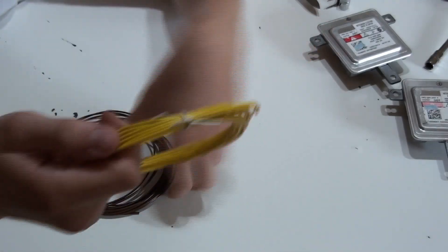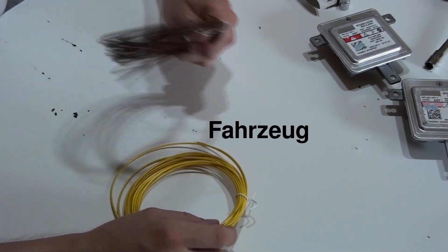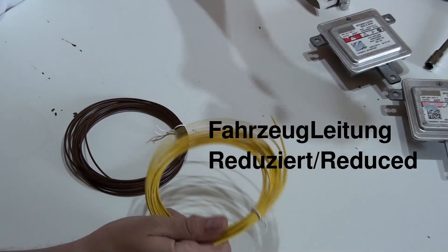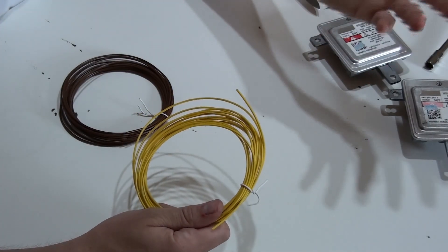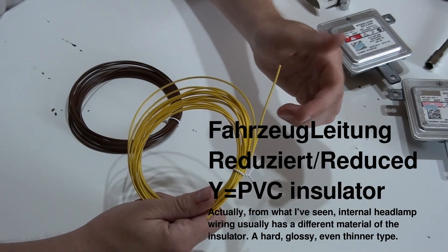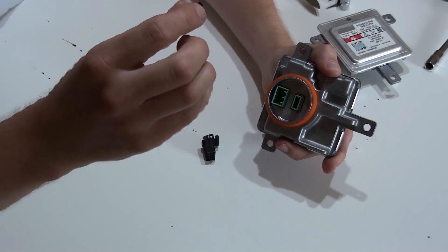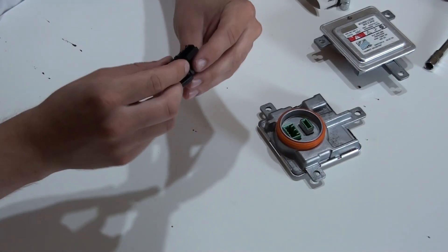The next thing is the type of wire. This is the so-called FLRY-B type of wire, where F stands for Fahrzeug in German, which is a car or vehicle. L stands for Leitung, which is the wire. R stands for Reduced Insulation here, because at 12 or 24 volts — depending on if it's a car or a truck — you don't need that thick of insulation as you need for home wiring and so on. And then Y stands for the fact that the insulator is made out of PVC. The dash B says that the wire is actually asymmetrical in its cross-section. After the wires, there are the connectors — the Tyco Multi-Lock 4-pin connectors, I think they are 070 series.